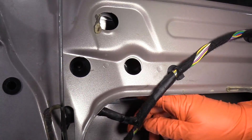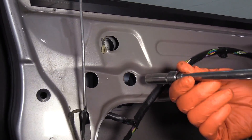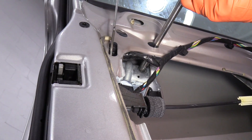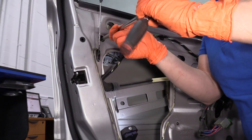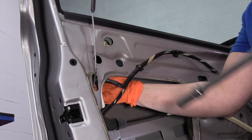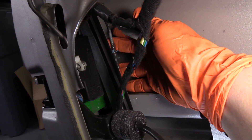To remove the outside door handle, we're going to remove these two mounting screws. It's a 10-millimeter socket, and there's an access hole through the inside door panel. Once the panel's off, you can line your socket up and break those nuts free. Next, we're going to disconnect the lock cylinder arm here. This is a little actuator that moves the latch up and down. See how it's threaded in the plastic? I like to take a small flathead screwdriver and pry it from the backside. I move the plastic clip around and pop it right off.